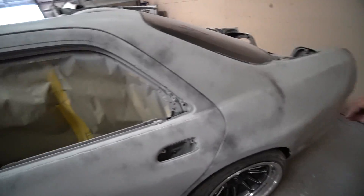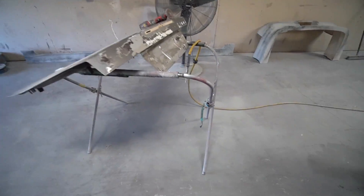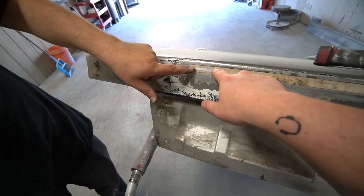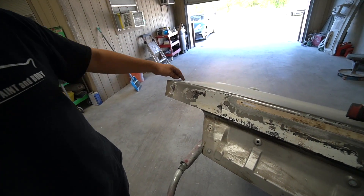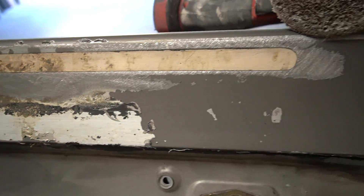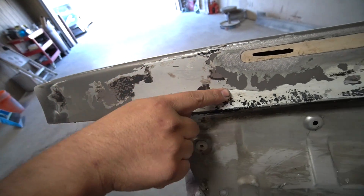I'm excited. If it matches that towards the back. So right now the hood — that's obviously going. You're working on this right now. What did they do for this? Well, you're not supposed to use body filler to fill in holes like this, because that's what causes the cracking. All this is basically body filler and they had tape in the back to hold it in. This is basically everything that was on there — silver, white. Nasty.